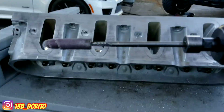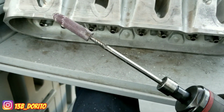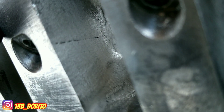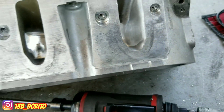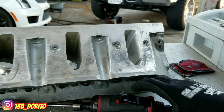I went ahead and I used this bad boy — I have a stock aluminum burr, about six to eight inches long. I stick it in there and I give it one pass so you guys can see how it is going to look. You see how it is already looking smooth? See the difference on the right to the left. That went all the way inside — you see there. Check this out — it is smooth. So don't get discouraged, because you are going to see all the jumping burrs and whatever, it is going to look rough. Don't worry about it, because when you pass it with the sanding roll it is going to start getting nice and smooth. That is all we need. If you see any imperfections or something going deep, leave it, because it is going to help you on the mixture — fuel and air.